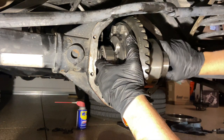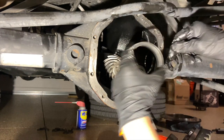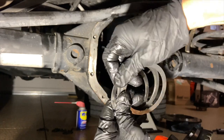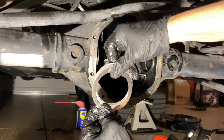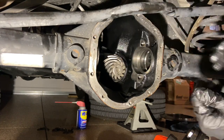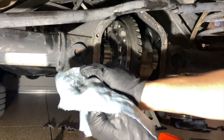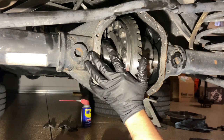I know you want it to be nice and tight but I couldn't even get it assembled. I may try to smear a little grease on these to try to hold everything together. So I'm just putting a little bit of grease on these to try to get them to hold together a little bit. I think that slid in a little bit too easily so I may have to get some shims a little thicker, because they seem to go in pretty easy, and you want the bearing preload to be nice and tight.